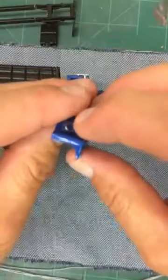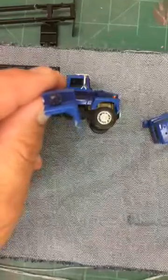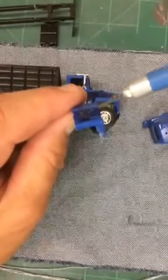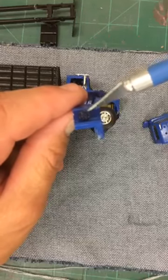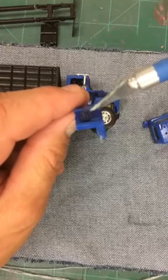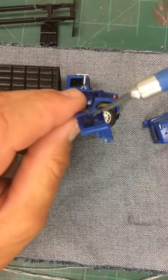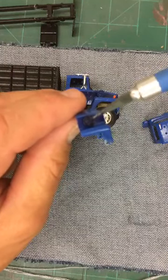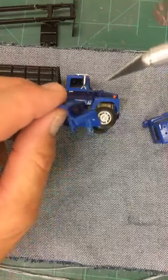Okay, now one other thing before we get going too deep. We have this air cleaner cap. This is plastic, and I told you do not, under any condition, take paint off of this with lacquer thinner, or dip it in lacquer thinner or anything like that. This is plastic and it'll turn to goo. So all I did was clean it with a rag of lacquer thinner, shoot primer and paint on top of it, and then put these on when you weren't watching.